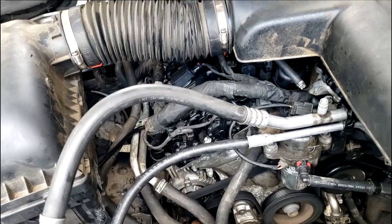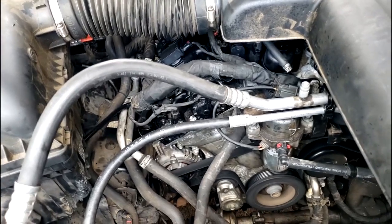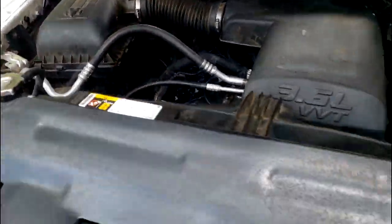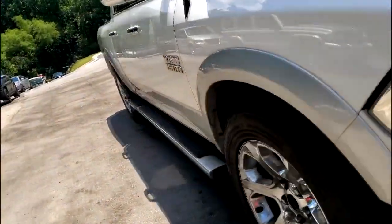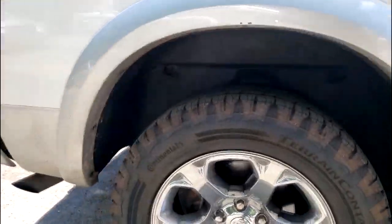It has a bad misfire. There are a couple of things that can cause this — remember the old days you could grab the throttle, but it's ETC, electronic throttle control. From my understanding, the engine head he got is low mileage, came out of a low mileage vehicle — that's enough to give a customer peace of mind. This has a tick and it's misfiring; they could very well be related. A rocker arm could cause both the ticking and the misfiring — you just don't know until you tear it apart.